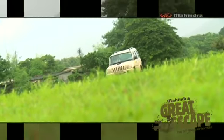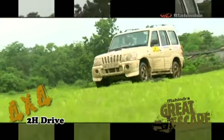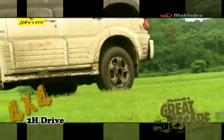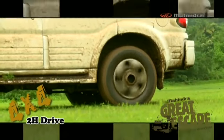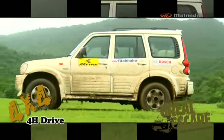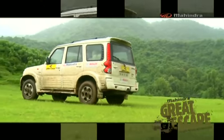We have a little grassy spot here and we are on 2-wheel drive right now. As we get into a little gradient, I'm going to get some wheel spin. As you can see, I'm not going much forward — I'm getting a lot of wheel spin in 2-wheel drive and have almost come to a stationary halt. This is where I shift into 4-wheel high, and watch how it pulls me out of this situation. This is the beauty of 4-wheel drive.